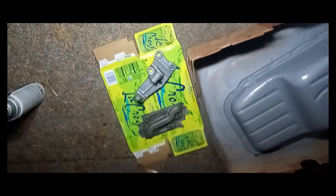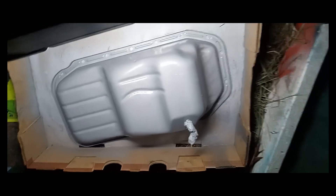That ain't too bad looking. You can see the difference in contrast and color — that is Rust-Oleum barbecue grill gray, which does a real good job of hiding stuff, seems to stick to rust very well, and has more heat tolerance than I need. I'm not sure how oil-resistant it ends up being — we'll find out. It'll look great, and with that not being black we'll actually be able to see if there's any leakage or seepage. Also, that's going to mount up against a black engine block, so it'll look real nice. Same color I did the valve cover in, so top and bottom match.